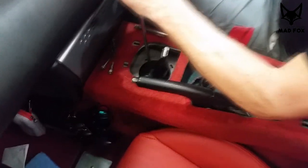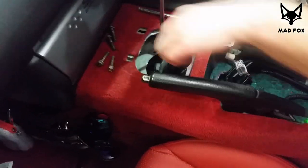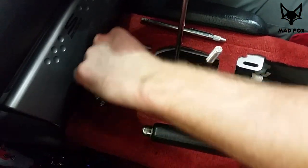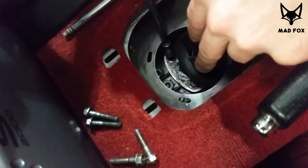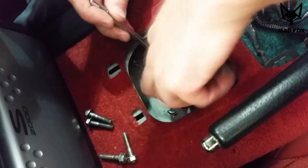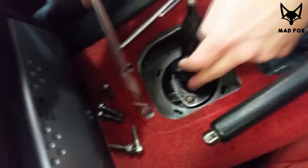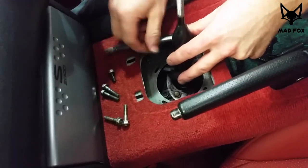Like you all know, we're doing everything live, so sometimes we make mistakes. You don't have to remove the top screws, the four ones. Under the rubber there are another three. It's only three. Under the small rubber thing, there are three screws, so unscrew them, the short ones. You don't have to unscrew the big ones. Sorry for that. Hopefully you watch the video first, then do it.